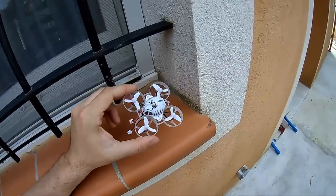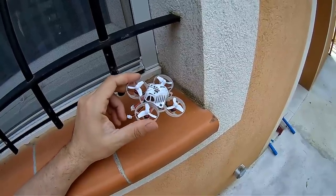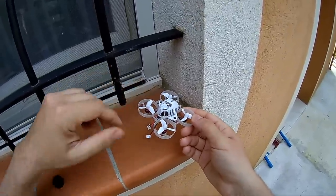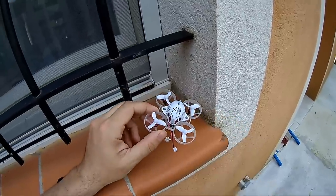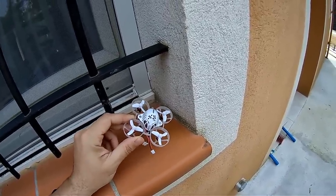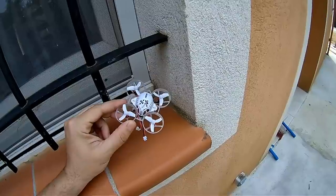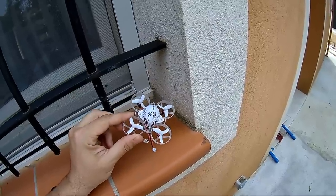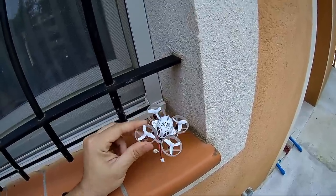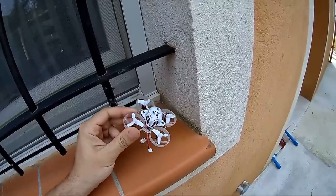The flight time is about 3 minutes, sometimes 3 minutes 30 maximum, but don't abuse the LiHV because they are known to have a shorter life. The number of charging cycles is limited, so I really recommend this machine. I like that the FrSky receiver works well. You enjoy telemetry and you can read the current information thanks to the Crazybee F3 board. It's more or less well configured out of the box, except the OSD, where too much information is displayed from my point of view.